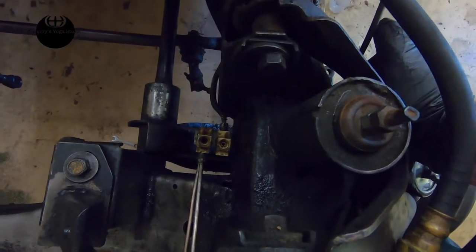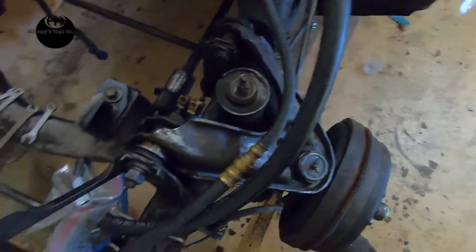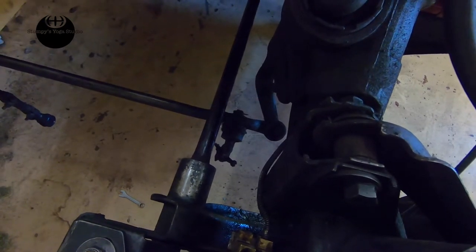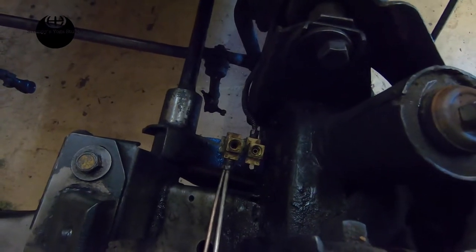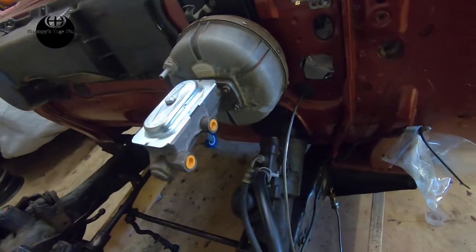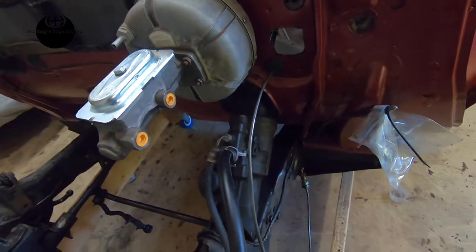And now that I look at it, I don't think that angle is too terrible. And it's got a sheath. I'll keep the sheath for when I do the back line, but I'll have to confirm that I'm not messing up that line as I do it. I don't think I am. That brake line is a lot more forgiving than fuel line, I find. So that's the idea there, is that now we have two ports. Now we got two open orifices, but we can block those off. So yeah, that's what I'm going to show you there.